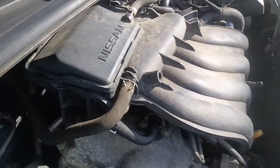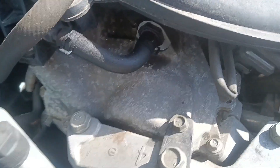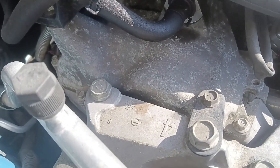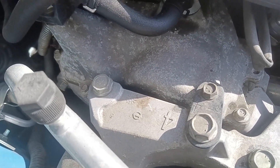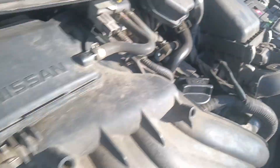We do have a valve cover gasket. Looks like the original might be RTV on this one, so I'm going to inspect it for leakage. If it shows me that it is not nasty, then they get to get their money back on that part. We're going to inspect it, but off comes the intake manifold to reach those coil packs.